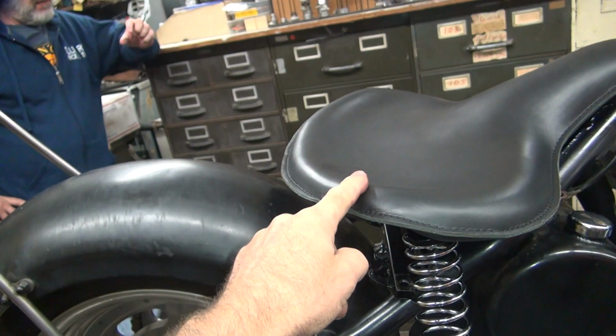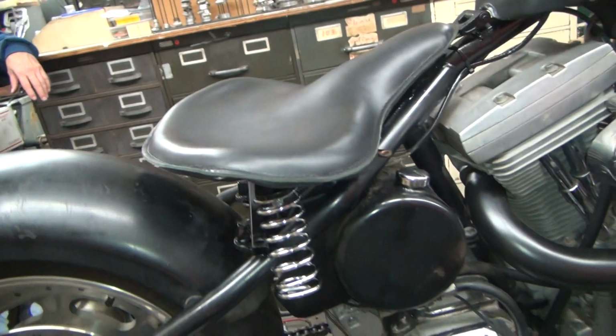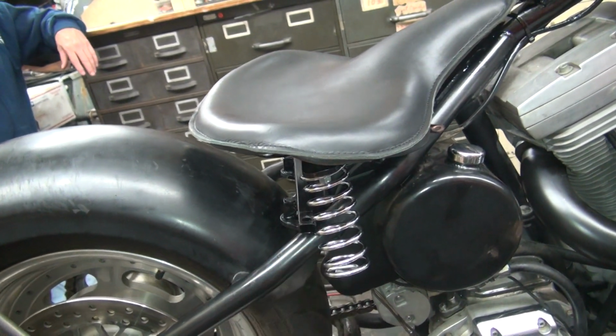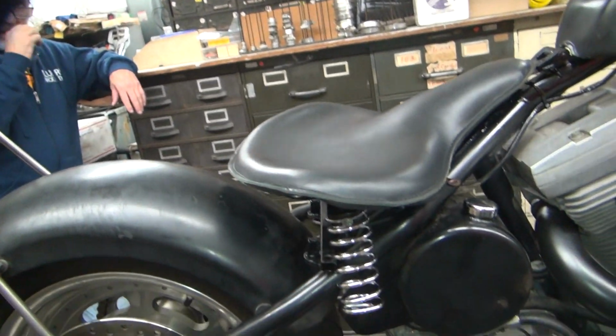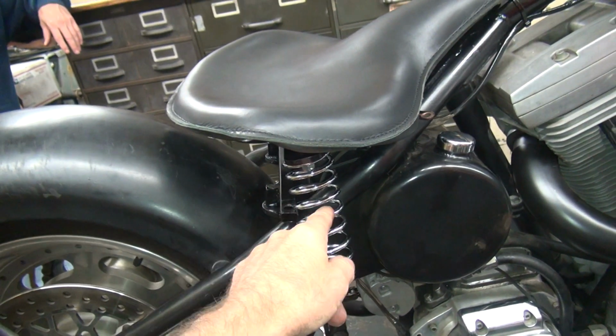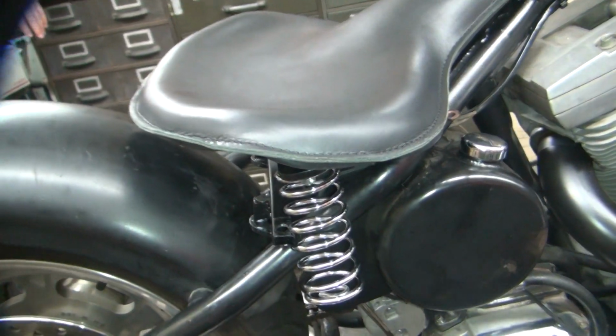But the seat wasn't this far because he said it was up higher. He had like 3 fingers in here, 4 fingers. Yeah, when it was bottoming. So that means we got to come back about 1/3 of the distance. But the spring was like bent. Yeah, it had a big S bend in it. So we're going to make a bracket that moves the pivot point, or I mean the bolt point, forward, but not the width of this, just 2/3 the width.